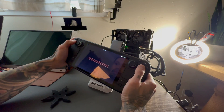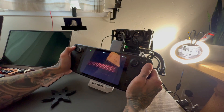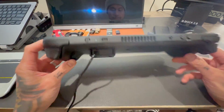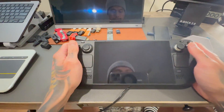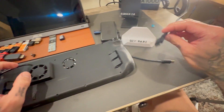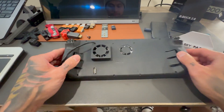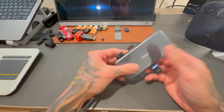Doing 800p, RT medium, RT ultra, all the high graphics presets on a handheld is a really nice experience. By no means is this a tutorial video — I just want to quickly break down everything you need to tie an eGPU to your Steam Deck. The main thing is obviously a Steam Deck and access to your M.2 port, whether it's an Oculink or an M.2 to PCIe x16 slot.